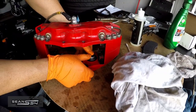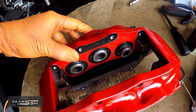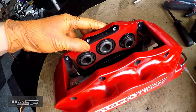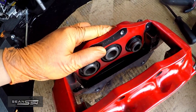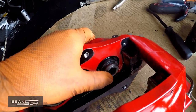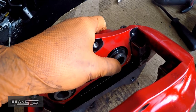With the knockback springs, it knocks back a little bit. I did a little more research about running without the dust boots and found that Performance Friction, PFC brakes, AP Racing, and the Stop Tech Trophy race big brake kit don't come with dust boots. For one, the dust boots get fried on a track car. Two, dust boots are really designed for a street car that may see rain, snow, and salt. Three, the dust boots make the anti-knockback springs less effective. So right now I'm going to run it without the dust boots and see how it goes — if I have any issues I can always add them back later.